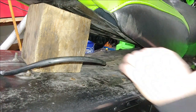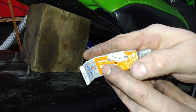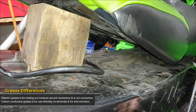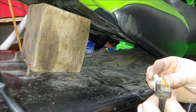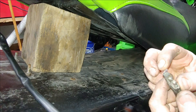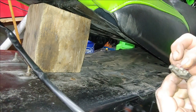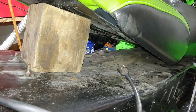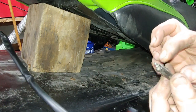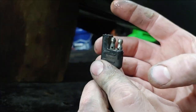This is what I was telling you guys about — this stuff, bulb grease. It says dielectric grease right on it. You do not want to coat the contacts — this is an insulating grease, not a conductive grease. The best way to use this is to just put a little tiny bit on your finger and then wipe it right on this edge here, all along this little base. What it does is it just seals out water.